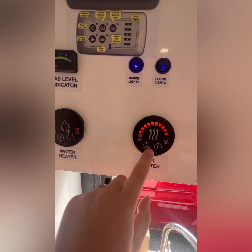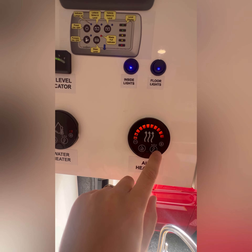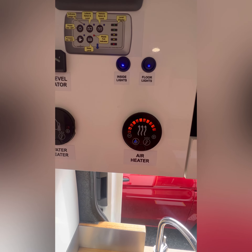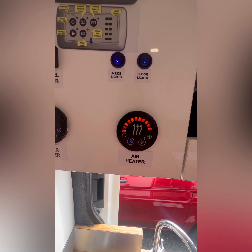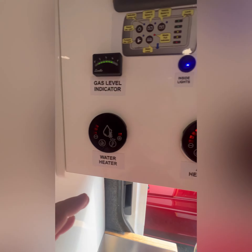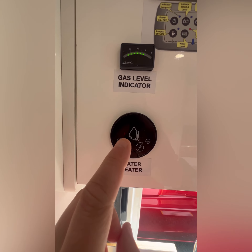This here is for when you've got electric hookup, and this is when you're running off gas. If you press that and the gas is on, it usually takes about 30 seconds to a minute. Once that goes red you've got your heater on. As you can see, you've got the exclamation mark — sometimes if they're turned on before the gas is on you'll have to reset the system.